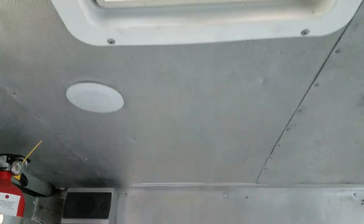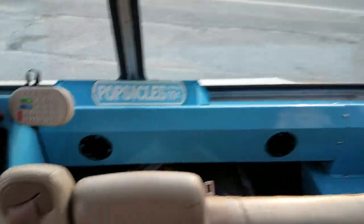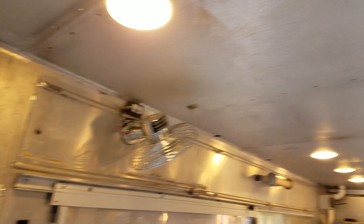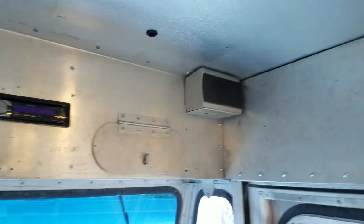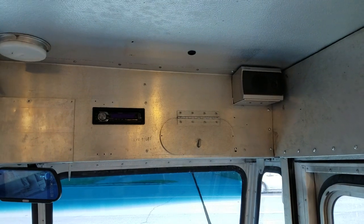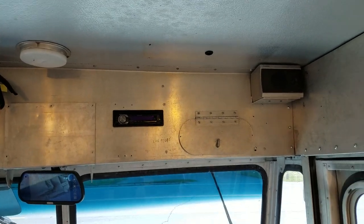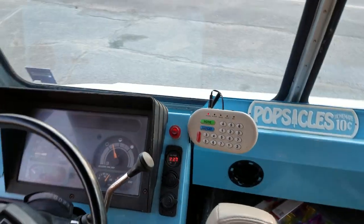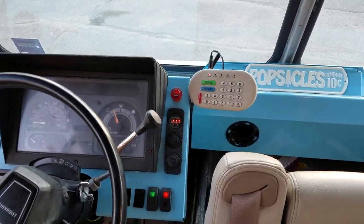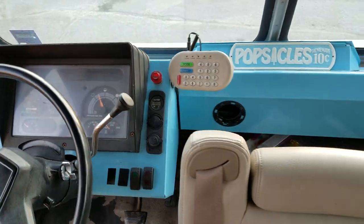While we're on the roof — fire extinguishers go with. I've got nine LED lights in here. Tons of lighting in here for nighttime work, and the LED lights last forever on the battery. It has two batteries up front. Usually you can work two, three, sometimes four hours running the porch lights and interior lights without starting the truck. I've wired this so you can separate out your accessory and watch the voltage — so you know if it gets down to ten and a half volts you can start the truck up and recharge.